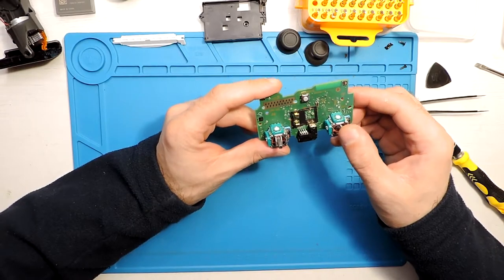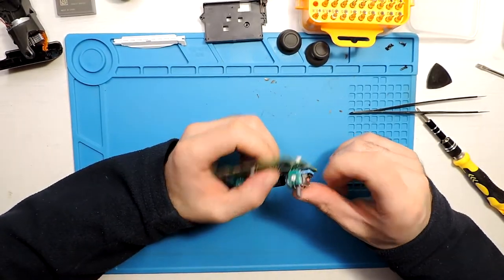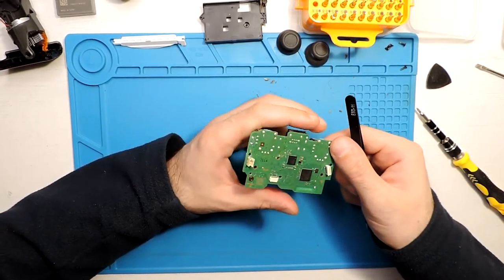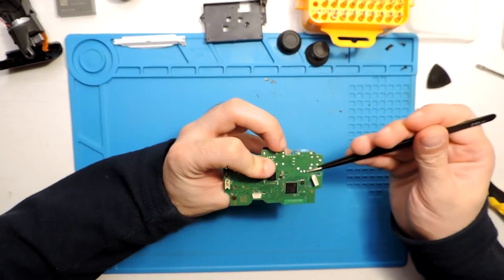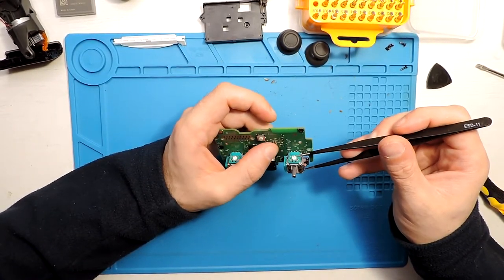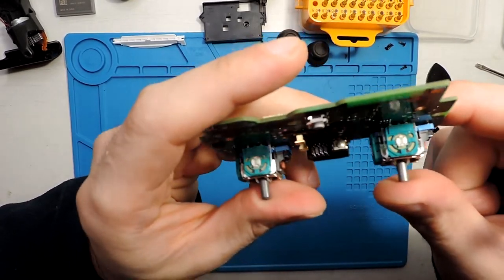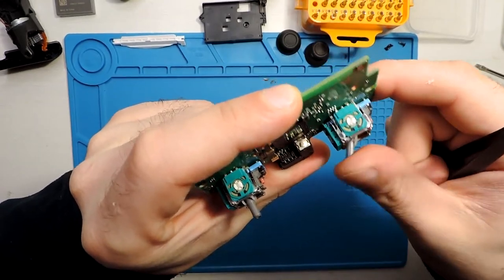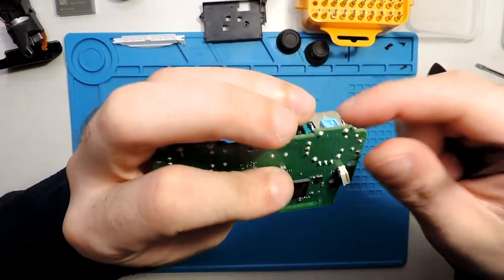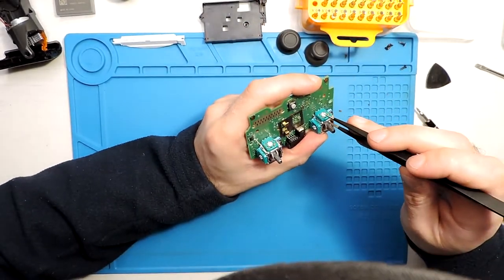Okay, so the issue here is this one over here. Actually, I never took any of these apart, so I'm not sure. If I try to unsolder these three pins over here, I might be able to take out this part, because this is what moves when we go to the sides. It was when we had the issue. So if you can see, when I move it, it moves only this part. This one doesn't move, only when going up and down. So I think if I try to unsolder these ones, maybe I can try to take out this one,